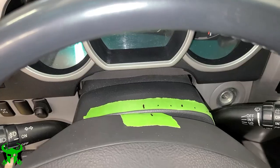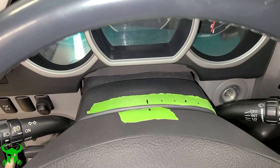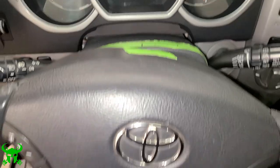I'm at the limit of what I can adjust here right now because of maybe the quality of the part, and the steering wheel is nearly straight — off by about five degrees. To get that last five degrees, I'll have to take it to an alignment shop, because they'll be able to work with the tie rod ends and really get it dialed in straight. That requires an alignment machine. Even if you had an OEM Toyota part, you might have to get it aligned as well, just to get it perfectly dialed in.